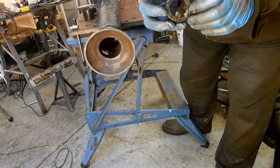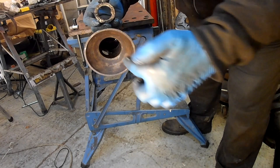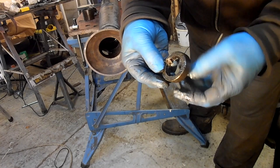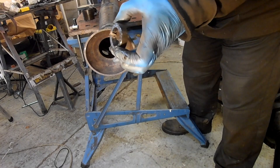The important thing is that the seal is fitted in such a way that it's designed to stop the oil and grease coming from the UJ cavity into the torque tube — it's not there to keep the axle oil in the axle. That's the end that I hit on there, and this is the end where you can get your thumb under the edge of the lip seal. There's the seal, there's the bearing — both successfully removed.